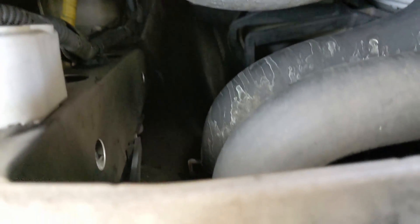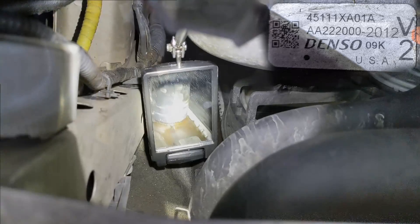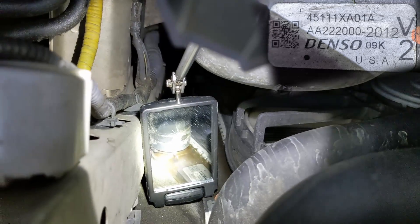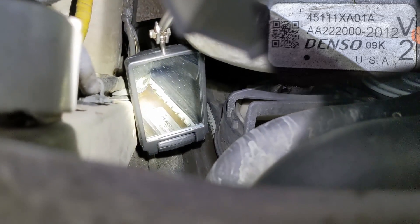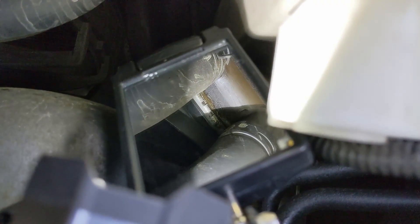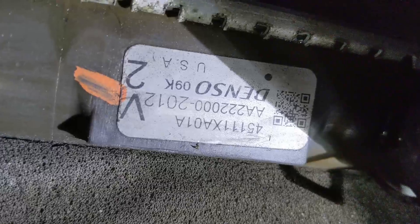I can see where the coolant has been on top of the lower hose. I was hoping just the top hose was leaking, or maybe even a clamp — hoping to get by a little bit cheaper. But it's looking like there's a lot of discoloration and staining around this joint here, from the radiator to the plastic end cap. That's a compression-manufactured clamp, and it's definitely been leaking around there. You can see between the hoses there's a little bit of corrosion and buildup at that joint.